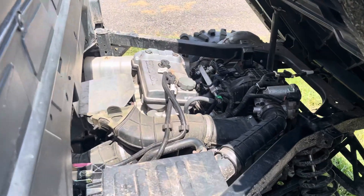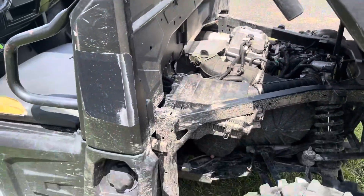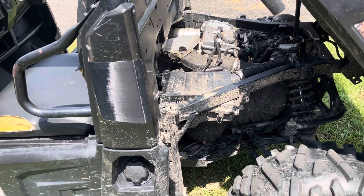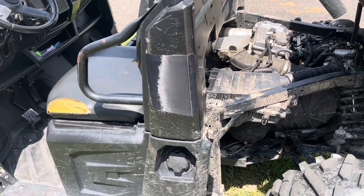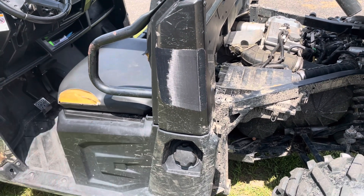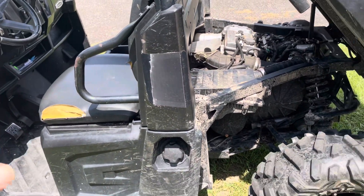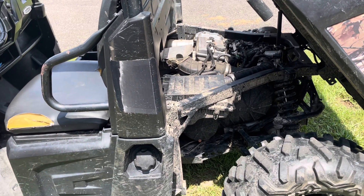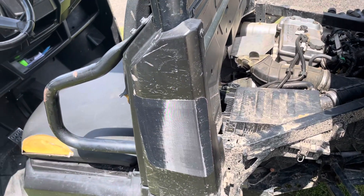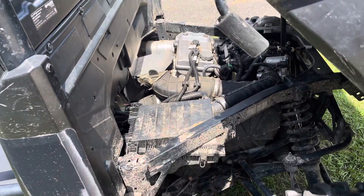After cleaning the throttle body and everything, it cleaned up everything else, but the situation where it gets hot and goes crazy is still there. On this particular model, the 900 — which typically doesn't have too many runnability issues — if you're having that feeling of losing throttle actuation at steady throttle, it's coming back in and out. If I let off, it went back in and was fine; if I punched it, it would be fine. But doing that would change the temperature too, because letting off and giving it gas changes water flow and water pump pressure. Get on the road with airflow and it cools down — so it is still kind of working, just erratic.